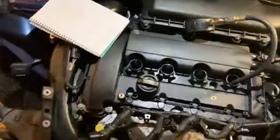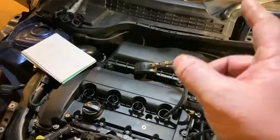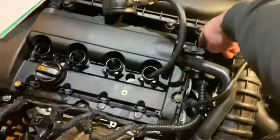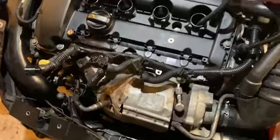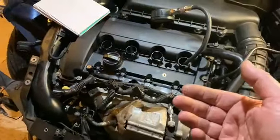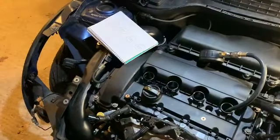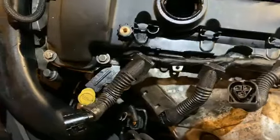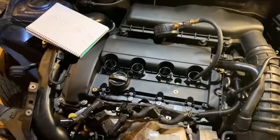Next I'll check air and fuel. I looked on YouTube and a few people are saying there's a fuel pump on the inside that sticks and doesn't work properly — maybe it's that. Or maybe it's the high-pressure fuel pump. A couple of people are also saying to check the timing again, make sure it's right. So do I whip the cam cover off again and go underneath and check the timing tool and make sure it's all lined up?